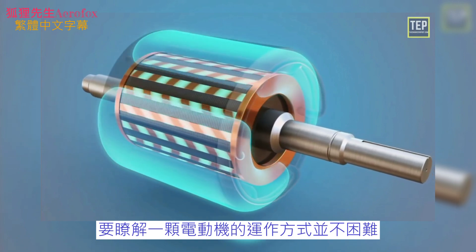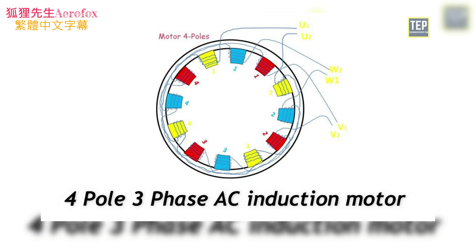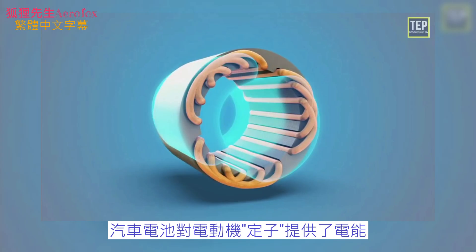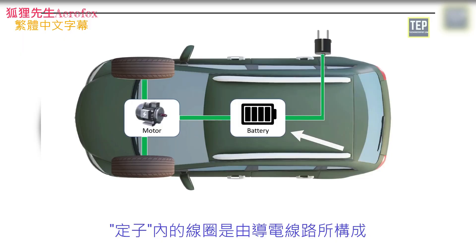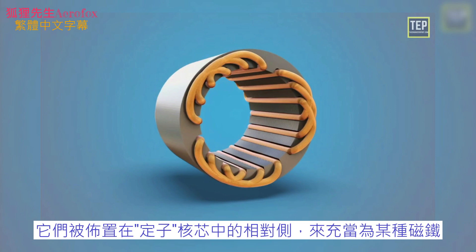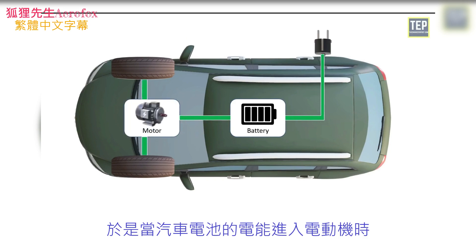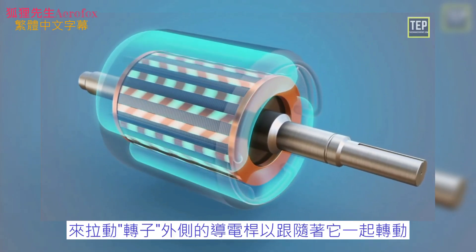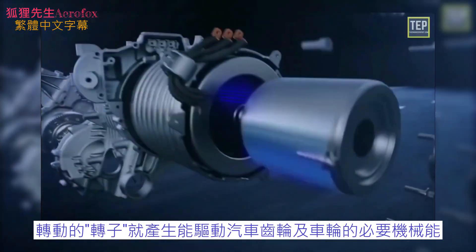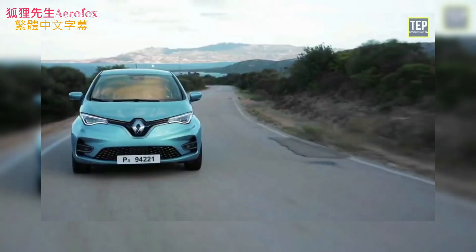Here's the simplified explanation of how a four-pole three-phase AC induction motor works in a car. It starts with the battery connected to the motor. Electrical energy is supplied to the stator, and the coils within the stator, arranged on opposite sides of the stator core, act as magnets. When electrical energy is supplied, the coils create rotating magnetic fields that pull the conducting rods on the outside of the rotor along behind it. The spinning rotor creates the mechanical energy needed to turn the gears and rotate the tires.